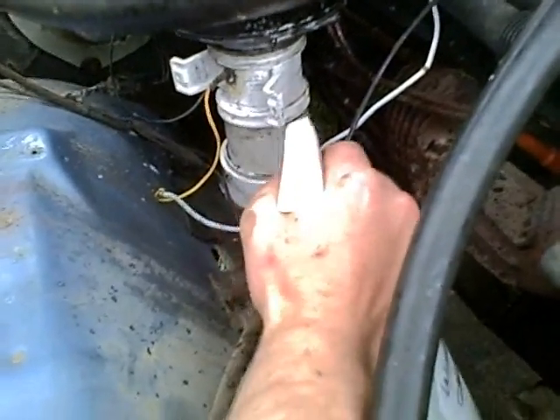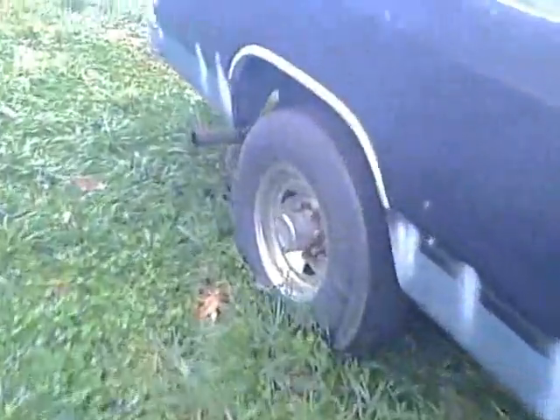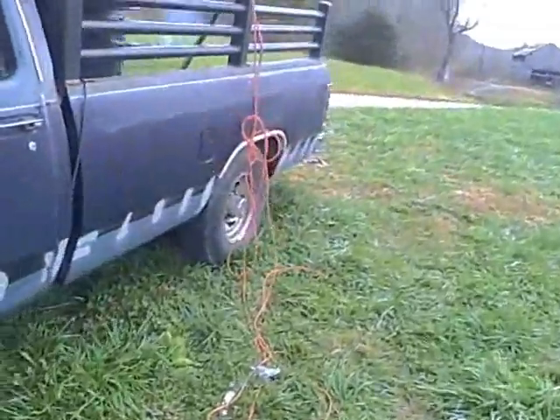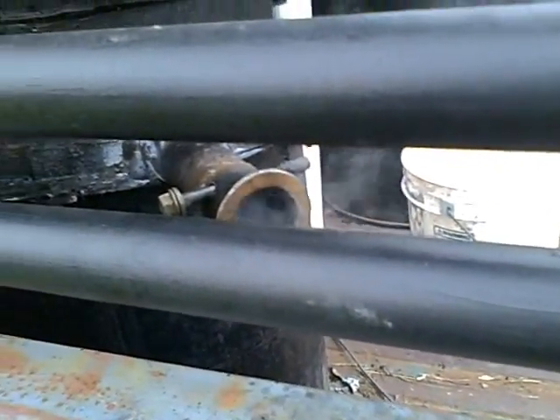Maybe that's the source of my problems. I mean, I have been continually improving this, and it's not gotten the truck to where it'll start. That goes on down under the truck. There are a few more connections, and I've been over these a bunch of times. There's really no leaks at all — most of these joints are glued, and the same goes for the rest of the truck. I'll take the opportunity to show you my check valve. I've got it forced open right now, but as soon as I take this out — it is considerably slowed. It goes in, not out — you can imagine how much smoke would come out if it was.